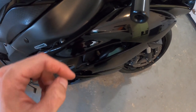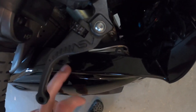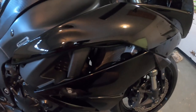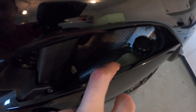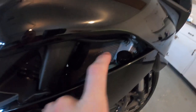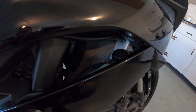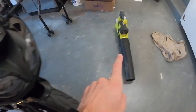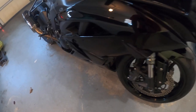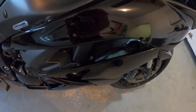I started it up once with the radiator cap off and overfilled the reservoir. The second time, after it cooled down, I threw the radiator cap back on and started it back up, let it cycle. Now I'm going to let it cool all the way down — in theory it should suck fluid out of the reservoir as needed. From there I'll pull the radiator cap off the actual radiator and check the level. I'm going to run the leaf blower on it for a bit to help it cool down more quickly so I can hopefully get this project buttoned up this evening.